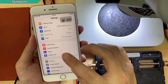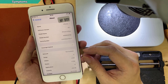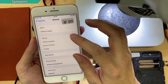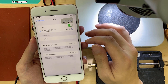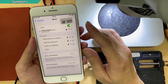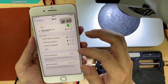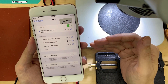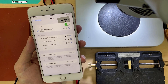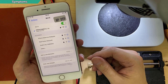I have a case here — an iPhone 8 Plus which only has a Wi-Fi problem. Everything is working but the Wi-Fi; not only is the signal weak, we can only detect the 5G connection. There's no 2.4G at all. My team has already tested the whole housing and the antenna — they are not the problem. So what's left is only the motherboard.